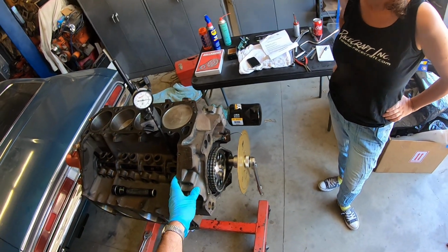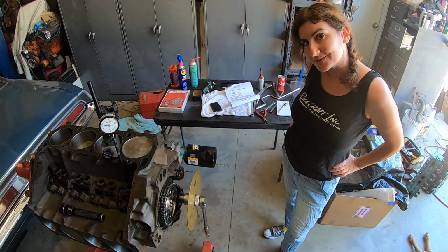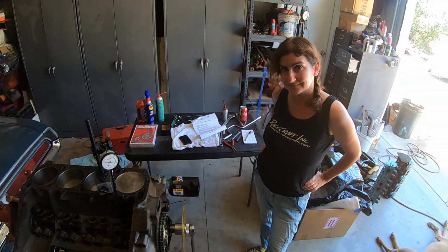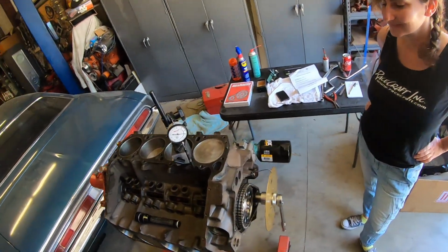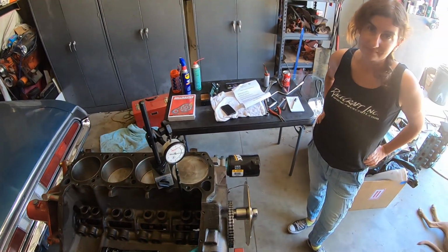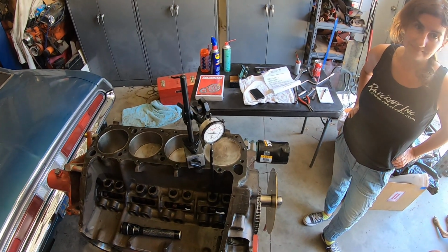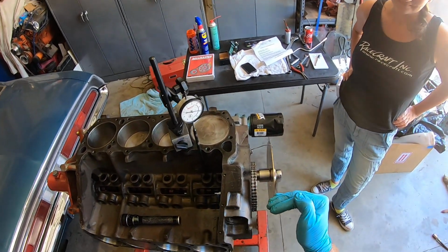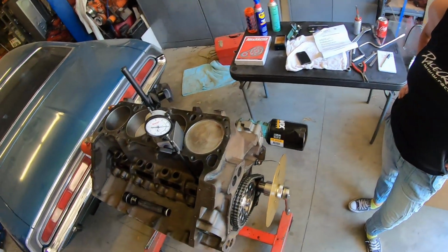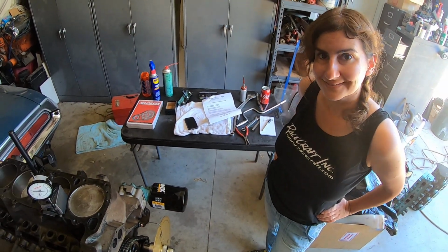It's just a short little video on degreeing the camshaft. What happens if you don't degree the camshaft? You could luck in that everything is perfect and you're happily motoring. Or you could have an engine that doesn't run right. It'll run low power or too much power at, like, say, the bottom end. It's an important detail to ensure that you have the cam in the right relationship with the crankshaft. You can't set anything else unless you've got this right. Yeah, that's it. All right, go do it. Yep, 5-minute job.